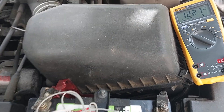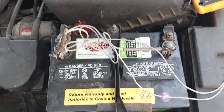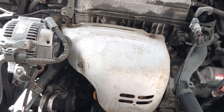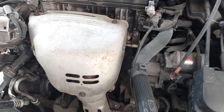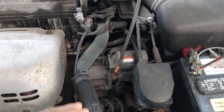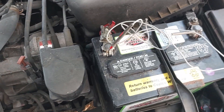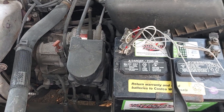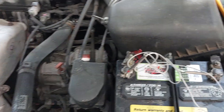I've got the car turned off now, but you can see the battery bouncing back. If you leave it too long or it's just getting drawn out like that, it's going to actually hurt the battery a lot. I first noticed this when I was actually driving home, and luckily I was only maybe less than a quarter of a mile from my house. The RPM just dropped, the clock turned off, radio turned off, AC turned off.